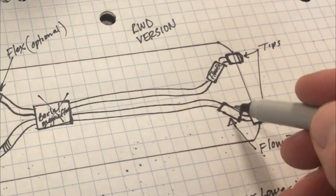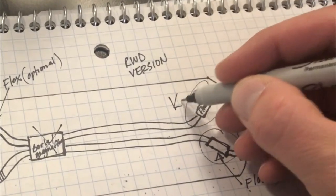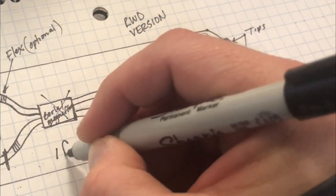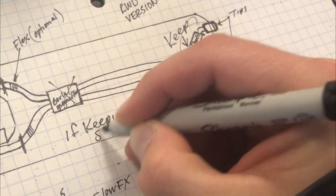And I'll link all this stuff in the description below so you can have an idea with quantities as well, so you know exactly what you're looking for. But you could do the flanges back to an X-pipe and then just branch those back off to your tailpipes using the flowfx resonators. So those resonators out back will just kill any of that rasp that you might get because your factory muffler is gone, your factory resonators are gone. So you're basically just replacing your factory resonators with a little bit larger ones.